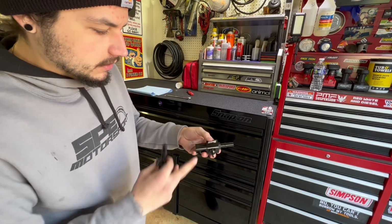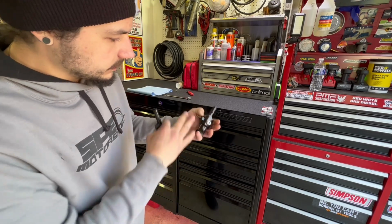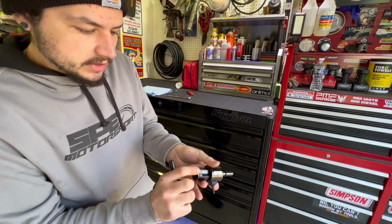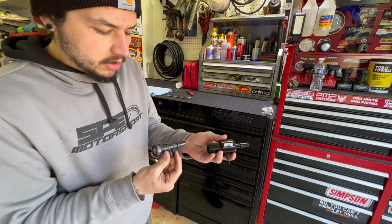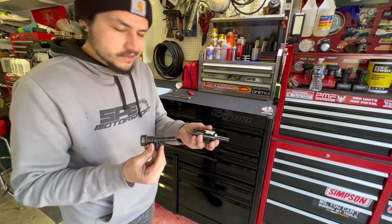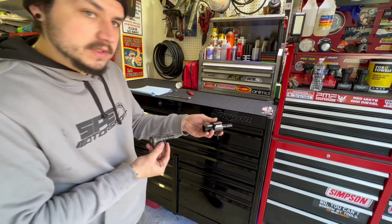Like I said, I put everything together, O-ring seal, O-ring seal, and put some thread tape on the plug back here. Excuse the diesel fuel on my hands a little bit there, but this retains the same push on and off connection right here. So this is what we're going with, and this is what we had right here. We're gonna show you putting it on the truck, which is connecting in, and we already snipped the hose. We'll push it on here and use that clamp, tighten it down.